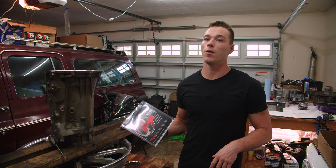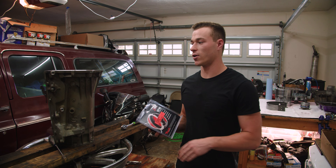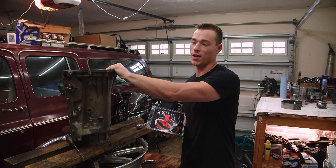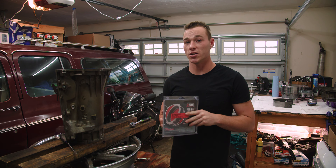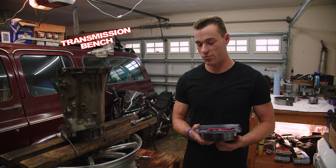This product is a little different than what you would find for your stock replacement clutch packs. If we open this up, you can see here, instead of having alternating frictions and steels, it's one side steel, one side friction for all of these rings. It's advertised that it takes heat without coning, which we have really no idea what that means, so if somebody can let us know in the comments, that would be great. People on forums mentioned not having much luck over 500 horsepower with these clutch packs.